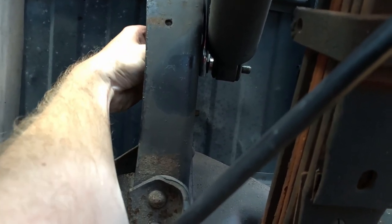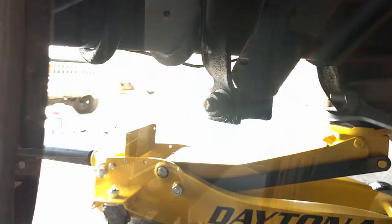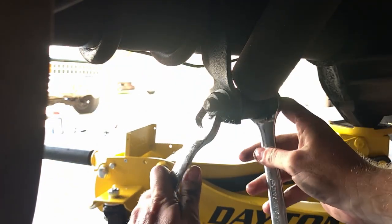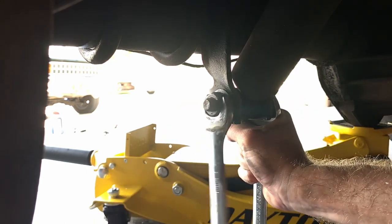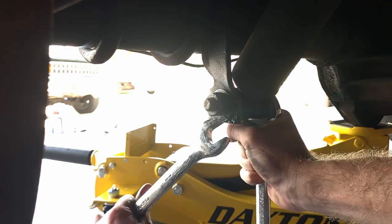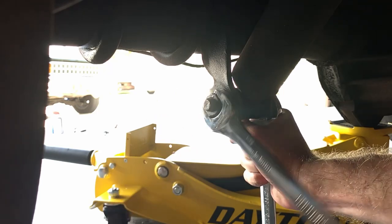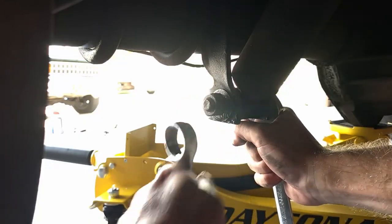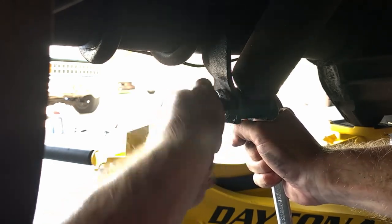Once that's complete you'll be able to either loosen or fully remove the top part of the shock. Now that we've at least loosened the frame mounting point, we'll move to the bottom mounting point for the shock. Much the same way, there will be a nut on one side and the bolt head on the other. Using two wrenches or socket wrenches you'll go ahead and break it free and then begin backing it all the way off. And as a reminder, once you are able to start backing off by hand, don't forget to remove the washers that are in place to help buffer the fasteners as well.